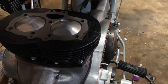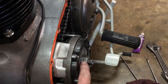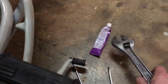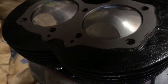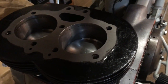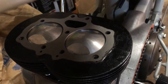Et voila — job done! I did a bit of dressing to assist that and just had to be very patient, gently easing the barrels down while constantly manipulating the rings to ensure we didn't get any ring damage. Slowly but surely, moving a little bit at a time — one side and then the other — and eventually the oil rings went in and down it went. The motor turns nice and freely; turning it with a shifter on the rotor nut it moves easily, and that's the whole motor going including clutch and everything.